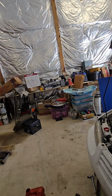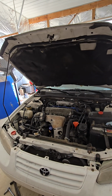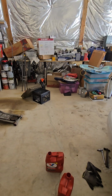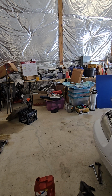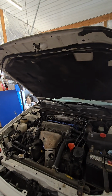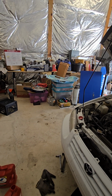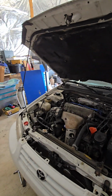So I always buy 2 gallons. I use either Dexron III with these old cars, that's what they came with from the factory. I'm using the WS, the full synthetic. People say different things. I've never had a problem switching these old Dexron IIIs over to Toyota World Standard, WS. That's just what I had in my cabinet, so that's what I'm using right now.